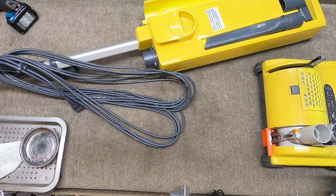Now we're going to get into the quick diagnostics before I put the covers on, to make sure everything is working right. Take this and place it just over that — you can also do it on the base of the unit, but I find this works just fine. Go ahead and insert the handle. With this attached, we saw the red light turn on — everything is adjusted. I always like to check it. Now we can separate the body and the motor and assemble everything, knowing no adjustments need to be made.